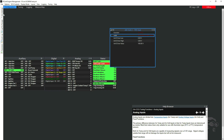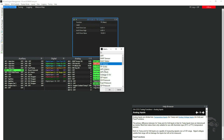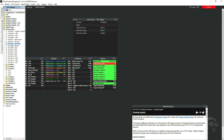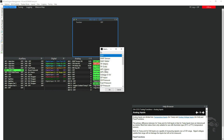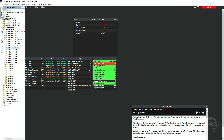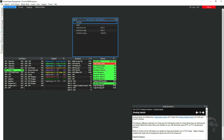Carry on — ECU settings, double-click analog volt 3. It's already TP main, but let's double-click to confirm it and label it TPS main. Next, analog volt 5 is APS sub — click function and select APS sub, then label it APS sub. And the last one for this part: analog volt 6 is APS main — function, APS main. Triple-check: analog volt 6, APS main.